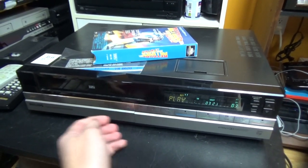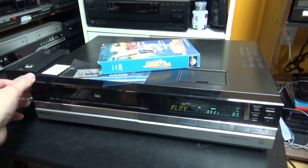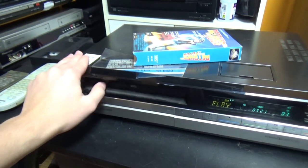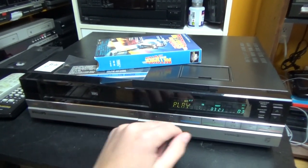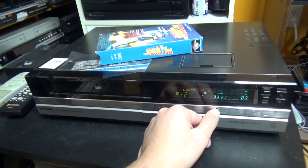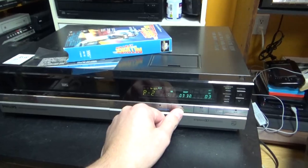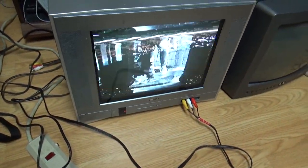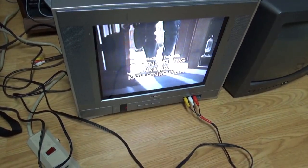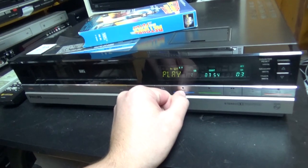I don't know if it has been repaired, but if not, that means the belts inside are still in very good condition. There are two belts in this VCR, and the pinch roller is still good. It uses an idler gear mechanism, which was pretty uncommon for 1985. It can also play at EP/SLP speed, though the picture isn't really good in that mode — it's probably just a two-head VCR, but it is stereo.